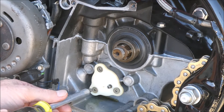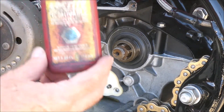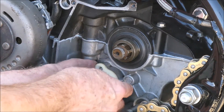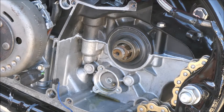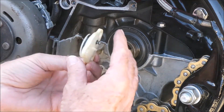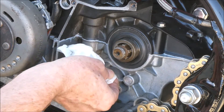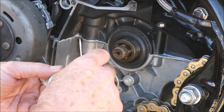They all have to have a crack — at least one crack, and right there is mine. Medium-strength blue Loctite. Here comes a little oil drip, but not much. This is definitely where the oil is coming from — that is the leak. Let me clean this out, make sure there's not something weird inside here. Doesn't see anything, looks pretty clean. The engine's all rebuilt and there's the obligatory crack in this plastic part.